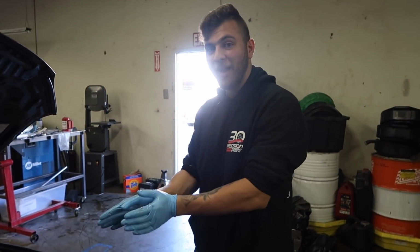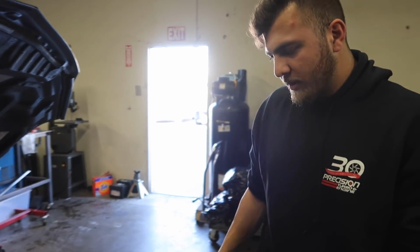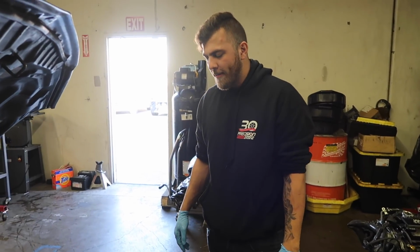Wiseco recommends 4.5 piston to wall. Yeah. So in theory, I'm bypassing that rule, going with a tight clearance, and I'm throwing that much boost at it. But again, it's on the machine work, if you have good machine work. Okay. Also, I went 105 foot-pounds. ARP says 100 pounds. You can go up to 110. But 105 is the sweet spot. I've always done it. I've never had any issues with that.